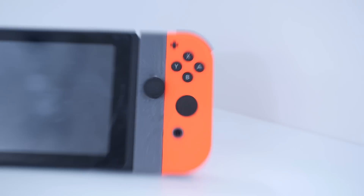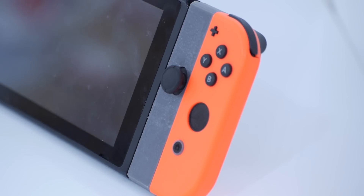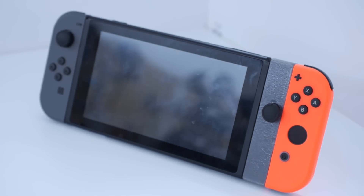Well Karen, we got the Nintendo Switch Joy-Con extended, and we put the analog stick where it belongs. This looks pretty slick. You did a great job, Ben, even though those tiny, tiny pins were very difficult to solder to. We're going to have the 3D print files for the extension online, but just to warn you — it is very difficult to solder, you're talking about half millimeter pitch sizes between wires. Do you have any ideas for other Switch mods? Tell us about it on the Element 14 community at element14.com/tbhs. You can also go there to read about upcoming episodes, builds, and special events.